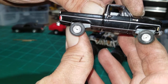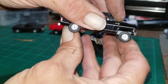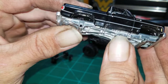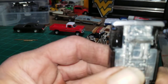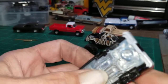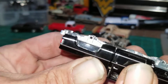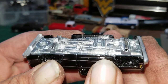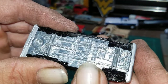As you can see, I've already popped the tires off. After I popped the wheels, I took my Dremel to them and did some grinding to flatten out the pumpkins. I got the front one there, spun it around, flattened out the back one. Then after I flattened them out with the Dremel, I took my flat file and just went across both of them to make sure everything was nice and smooth with no bumps anywhere.